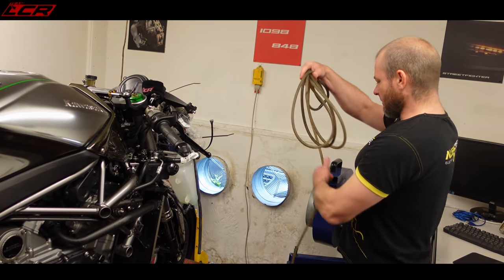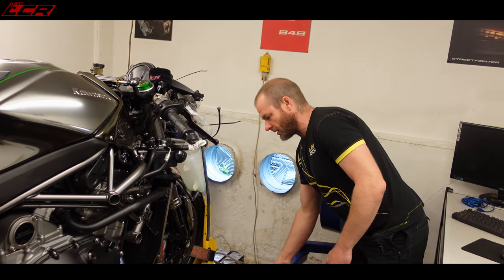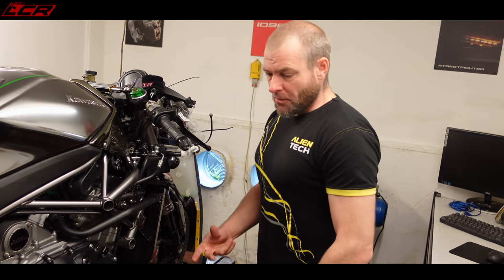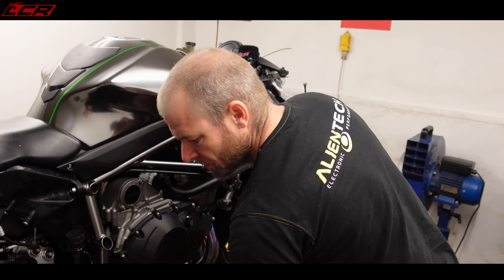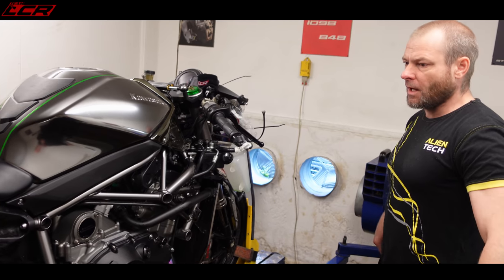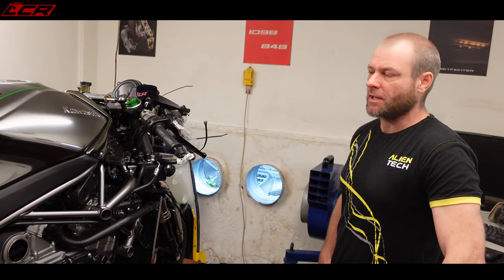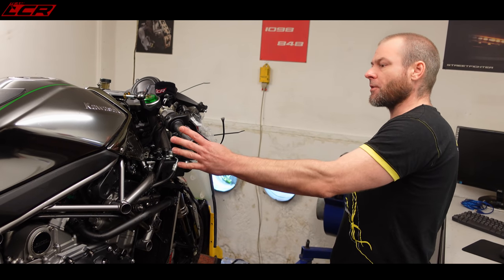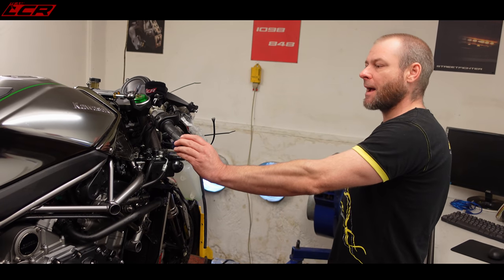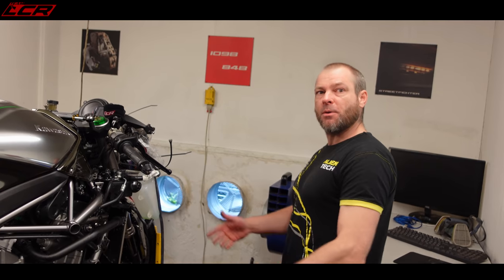Yeah, well, we'll get the fueling fixed. We'll see if we can remove the fuel cut, or should I say, re-enable the fuel cut. What's the fuel cut, what do you mean there? Well, when you shut the throttle off, on the older generation bikes, fuel was still delivered to the cylinder. Right. Since about 2012, maybe 2013, I'm not sure of the exact year, when you shut the throttle off, the fuel is completely shut off. So when you come back on the gas, it comes in with a big blurp. That could be the surge you're noticing then.